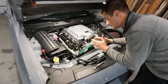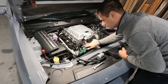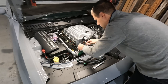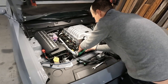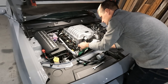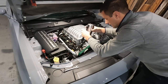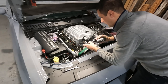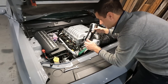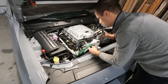For mounting the catch can in this Hellcat application, there is a stud hanging off the front timing cover. Included with the kit are flange nuts — the first one we thread onto that stud backwards, with the flange facing out, and tighten it down. Then we connect the hoses: the longer hose reaches back up to the valve cover location, and the shorter hose goes to the snout of the blower.